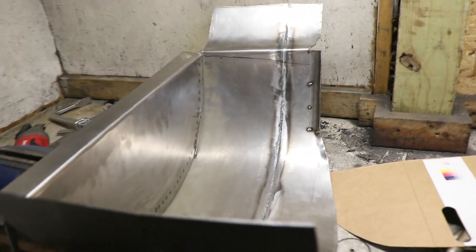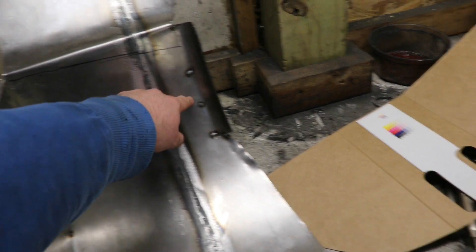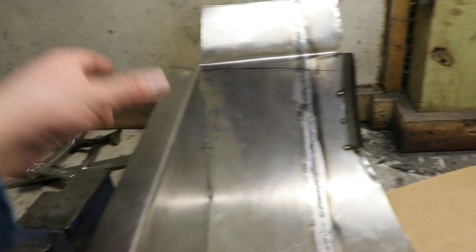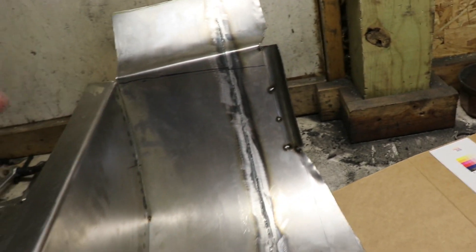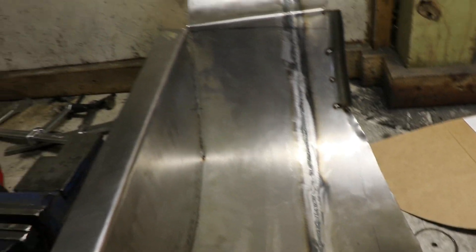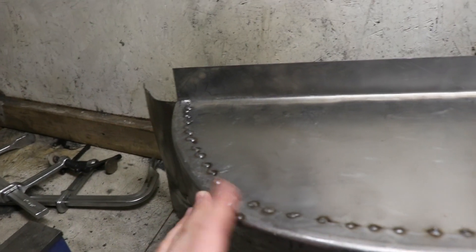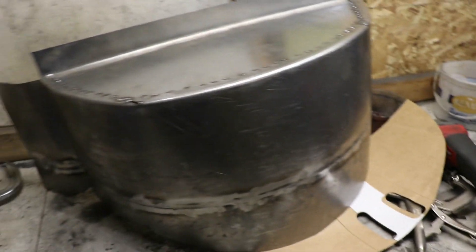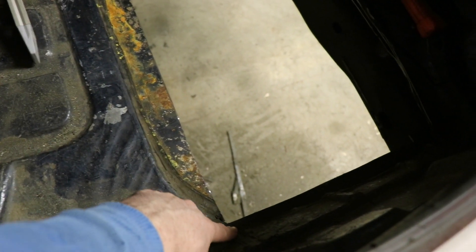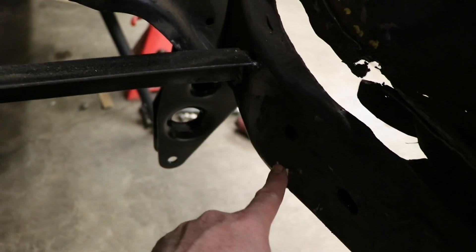Well, that whole plan went to crap. I ended up hitting the frame really badly because I didn't factor in how far the gas tank stuck out from its mount. I lost like four and a half inches off this side, which made me have to narrow everything up, and it was still hitting the frame. I'll probably just end up cutting it down and the wheel tub area that's left will just be what the tire fits in. I also had to notch it and bend it in on both sides because it was too long for sitting in the frame, and I had to hammer in a section of frame to get it to clear.